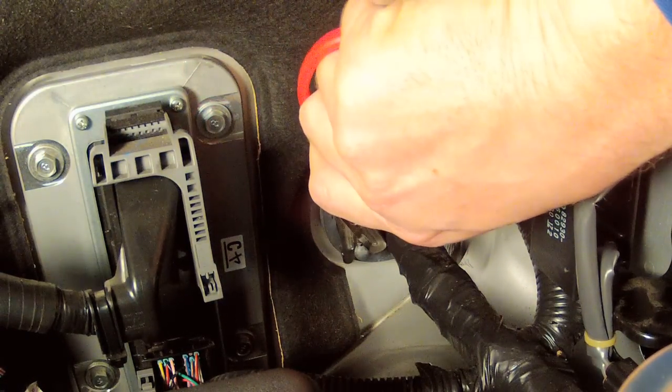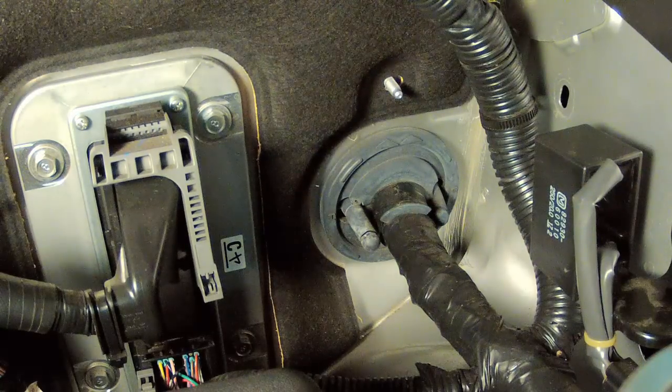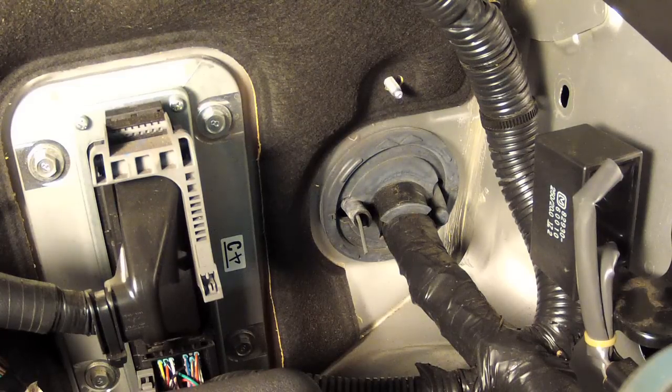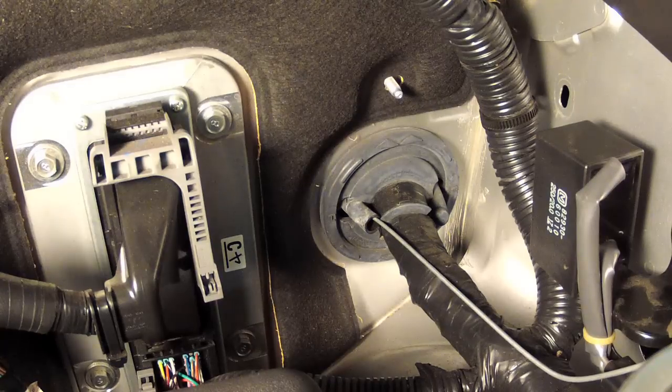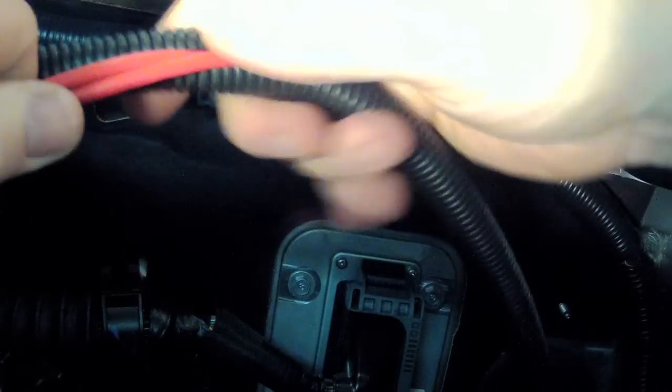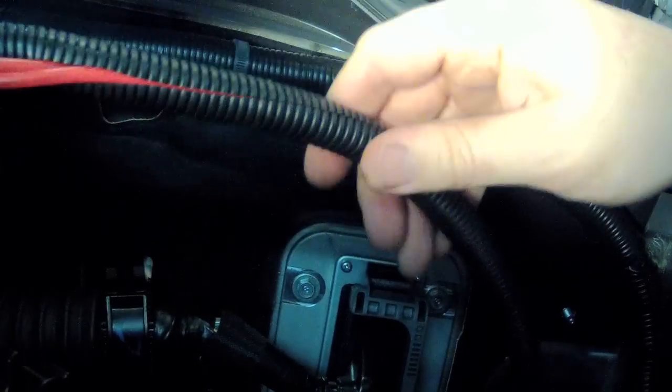Toyota make running accessory wiring through the firewall very simple by providing access nipples in the factory wiring grommets. Take advantage of them. I'll be taking the opportunity to run wires for future accessories at the same time as I wire the compressor. Running wires through split tubing prevents damage and gives a factory finish.